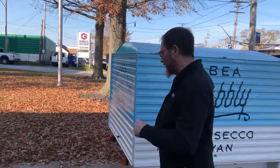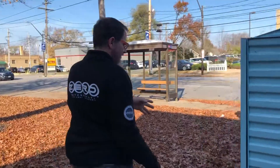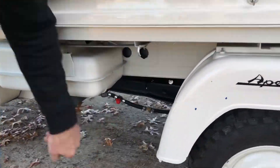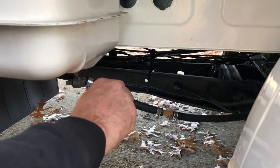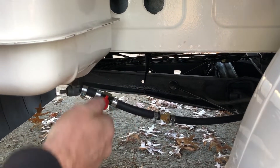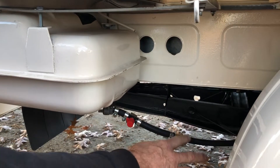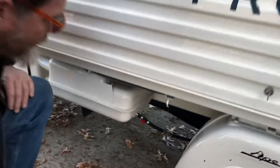Sway around with me to where the fuel tap is. The fuel tap is on the left-hand side of the vehicle. You're going to see it's this red knob right here. Make sure that it is turned so it's flat, in line with the fuel line. Straight up and down is off — that is on. There's a fuel filter right there; if you see that become contaminated, you're going to want to change that.